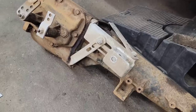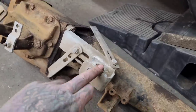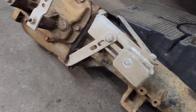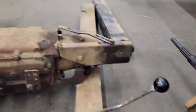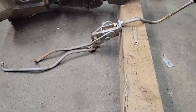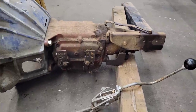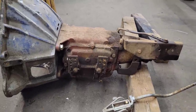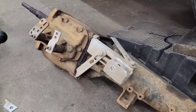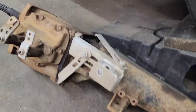So I got the shifter out of this bracket. Now, I know this is bent, I know it's binding. This looks bent, it looks bent down. That bracket looks bent, but those look okay. But that's double shear, so I think I've got to take that bracket and put it on there, and then I can put this shifter in and figure out if the rods fit. It's looking like it should work. Realistically, this stuff's all pretty universal. All I need to do is make those move front and back at appropriate times without mashing into each other. No big deal. I keep taking it apart, and then I'll start putting stuff back together until it all lines up. And I'll probably end up welding some stuff up.